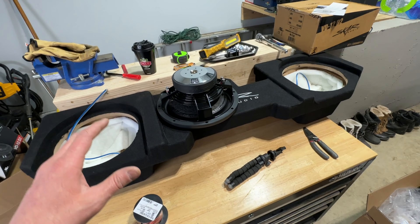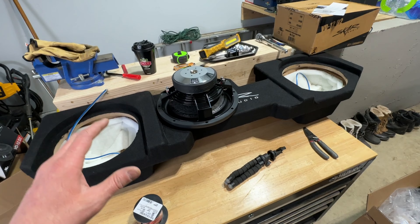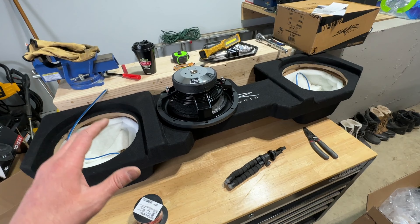The seat fits right over the top of the box. I can stick my hand up here — it's not pinching, there's plenty of room. The speaker area is recessed down about an inch below the top lip, so your seat is not going to smash the top of your speaker. The box fits, the seat covers it — we're good to go. Now I just need a little extra speaker wire to jump the two voice coils and hook everything up.